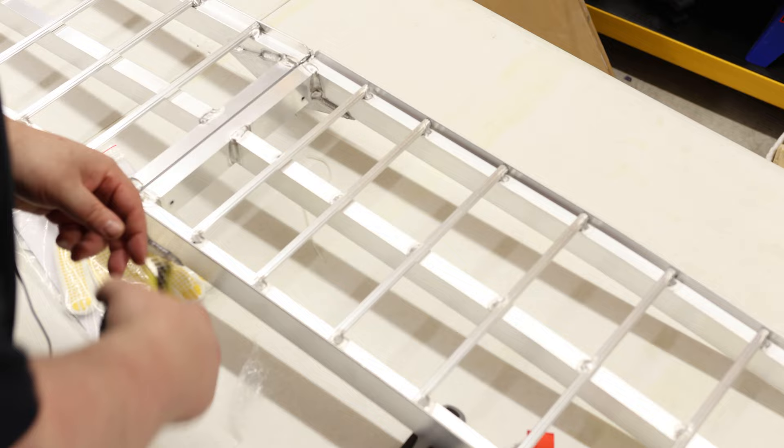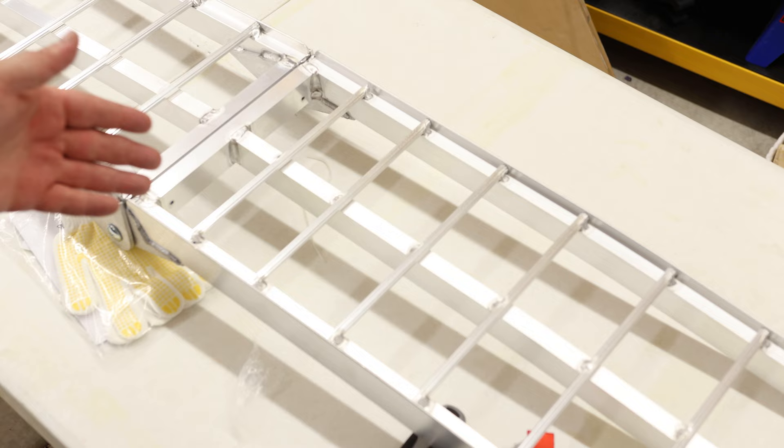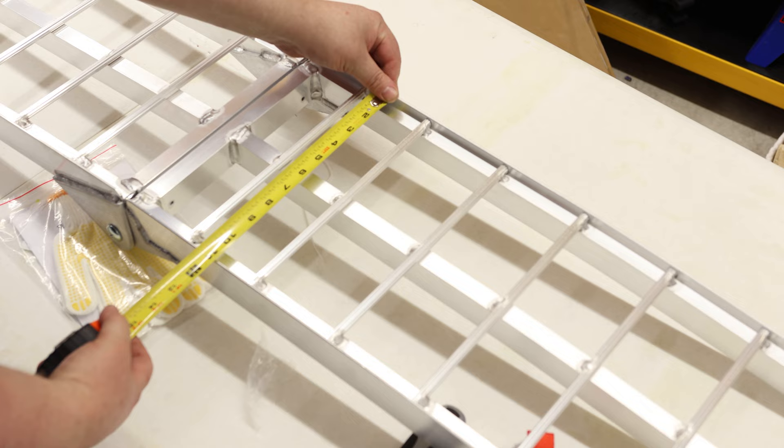The crossbars are spaced about three and a half inches apart, so even if you have a small tire like a moped, you're still going to be able to roll it up this ramp. The total width is a little bit over 11 inches — about 11 and three-eighths. There are some guide rails; they're not super deep, about a half-inch deep.